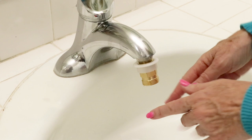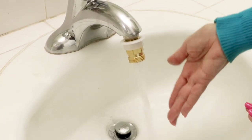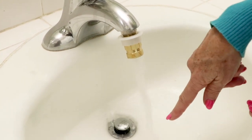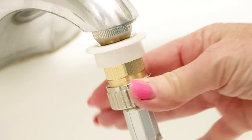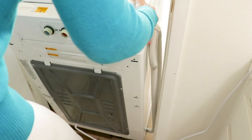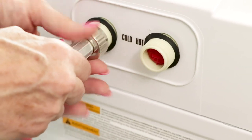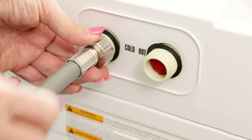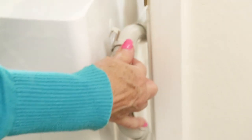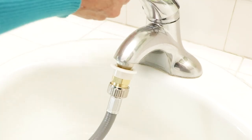Because I'm going to do a hot water wash I want to heat up my hot water — in my house it'll take maybe a minute to run before it's really hot. Now align the hot supply line right underneath it. I'm rolling the washing machine a little closer so it reaches the cold. The cold side is the side you want if you want water with just one inlet line — you use the cold. I'm going to take the drain hose and I can either have it drain into the sink.